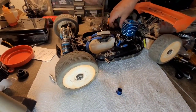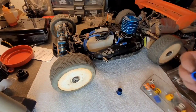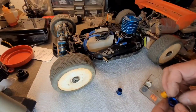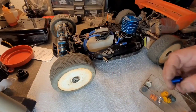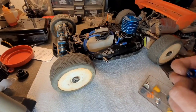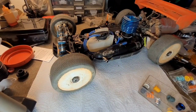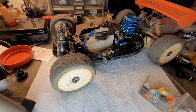You don't want your servos just sitting on. That's not good for them. I got a 7.5 here. Should we go for it, right? No, I don't. I want it to have the same Venturi as the 21AO so that I can gauge it against that. You know what I mean? So, yeah, let me go ahead and grab the 7mm Venturi off the 21AO.